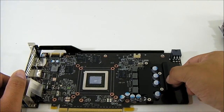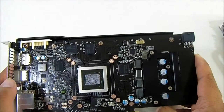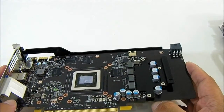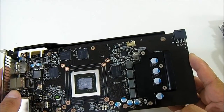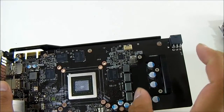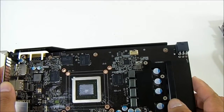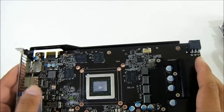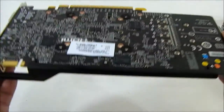Looking at the PCB, there's a heatsink over the PWM area, the exposed GK106 core with no integrated heatsink, and you can see the memory chips are Samsung memory chips. MSI uses solid aluminum core capacitors — high quality components. The PCB is a custom design; the typical GTX 660 PCB is actually shorter, and the extra area was used for a blower fan on reference designs. Since this uses the quieter Twin Frozr 3 solution, MSI had the freedom to design the layout differently.